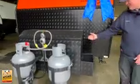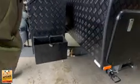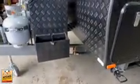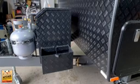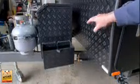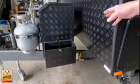Now coming down this side of the van, over here you've got a cold water tap. That's for cold running water outside, if you're cooking, doing those sorts of things. So it's a nice, convenient location to get it. Also, when you first go to a caravan park, a powered site, and you've got a water supply there, and you hook up your water, that's a good place to come to open it up and bleed any airlocks out. So when you first hook up your water, bleed your airlocks out, probably do it at that tap, and then you're good to go. And that will bleed out for all the infrastructure in the van? That'll get most of it, yes. Oh, that's gold, thank you.